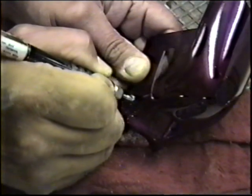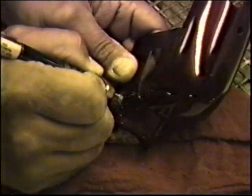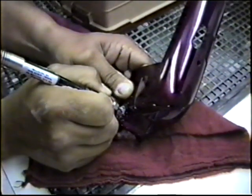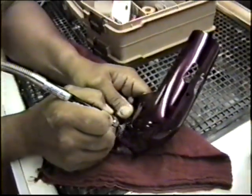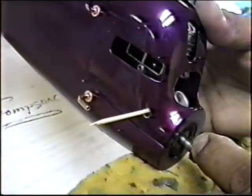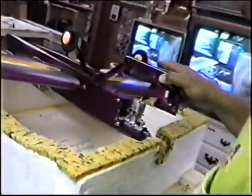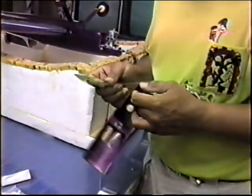Better to check the fit and go back over three or four times, because each time you'll see which side needs a little more clearance. If you make it too tight, then if you put offset in the motor, it hits the needle valve. So you want to have a little clearance, at least a 1/16 of an inch. We still want to go up toward the exhaust port some. Just use the next bigger circle on the circle template and bias it up in that direction.